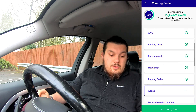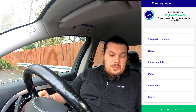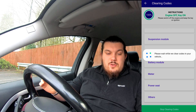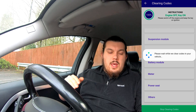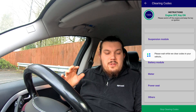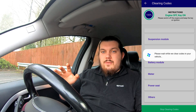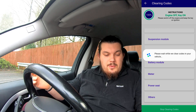Just waiting for this to finish off — it likes to go through and clear all modules even though there's nothing to clear. You can hit 'stop clearing codes' and confirm. The best thing about Garage Pro is it actually sends you a printout via PDF straight to email of all the codes, with explanations for what they are, reasons they could be happening, and possible fixes. You have to take them with a pinch of salt because they are globally recognised generic codes that come up across different cars, but it is really good. And Volvo are genuinely very good at following the internationally recognised code system.